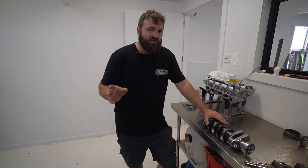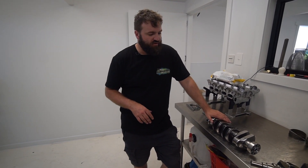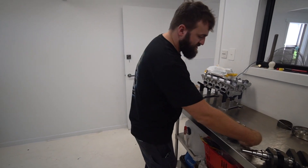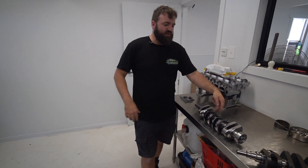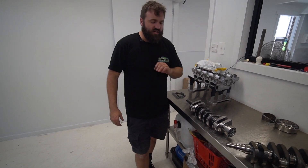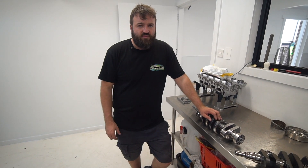That's all done by the crankshaft grinder. I tend not to deal with crankshafts that have been ground because, as discussed in another video, you can damage the phasing — where cylinder one and four are in line with each other in relation to two and three. I tend to use OEM virgin shafts that haven't been touched. I've seen issues with crankshaft grinders where when they put them in the jigs and tension them down, if their heads are unaligned it bends the shaft. We don't really have any good crankshaft grinders in Australia that I know of, and the one in Melbourne shut down because they couldn't maintain business.